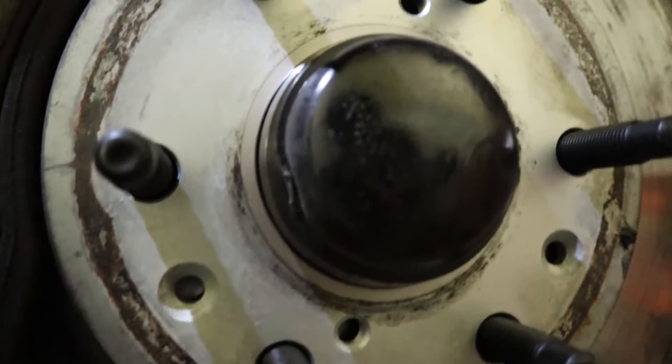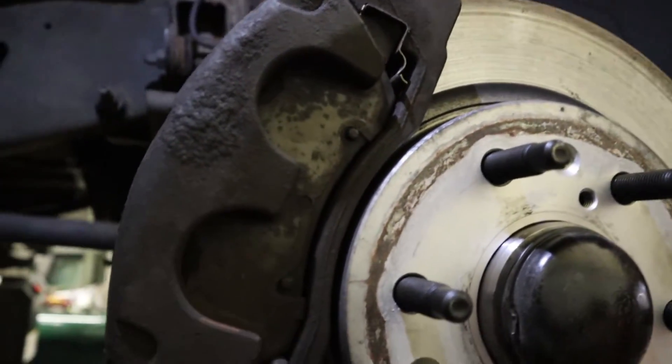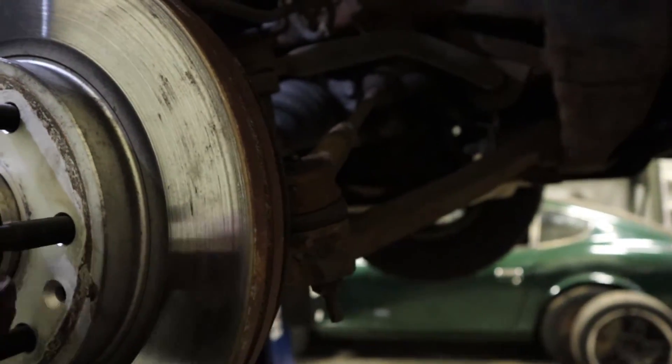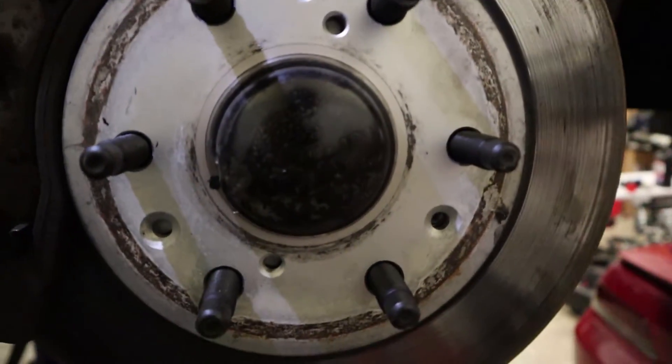Let's find a hammer - we'll use the old brass punch here. There we go, that's back on, so we are good. Nothing you guys can't do when it comes to a wheel bearing replacement on these. They can be a little tricky to get out - you can use some heat, or mostly I just use the air hammer with a tight wedge chisel, not one that's splayed out, but a really tight wedged one - you get in behind it and it pops out pretty easy.